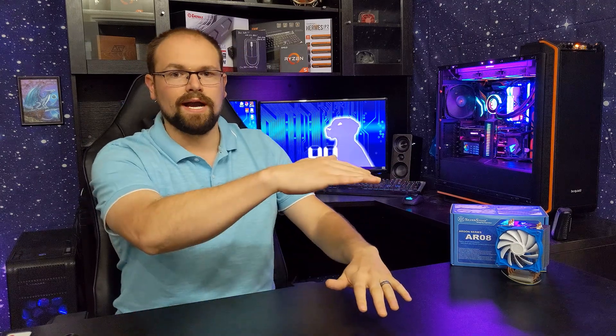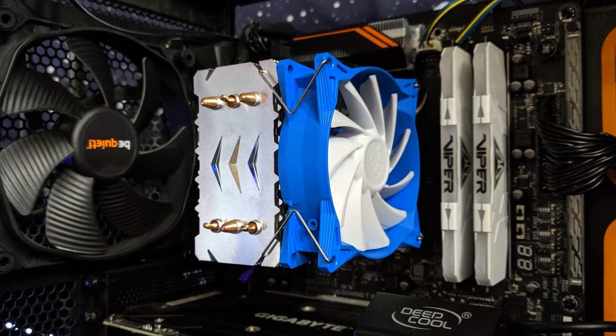What happens when you do that? If you turn the whole motherboard from being on its side to being on its back, and you have a low-profile cooler, you're blowing heat down into the motherboard. It has less chances to go anywhere because natural convection means heat wants to rise. If your board's upright, it helps exhaust heat out the top of the case. But if it's flat, you start getting recirculating heated air — you don't want that. Silverstone doesn't want you to do that. You can't put a 120mm tower in a slim home theater case, so this cooler makes all the sense in the world — it pushes heat out the back, front, or side, but not down.